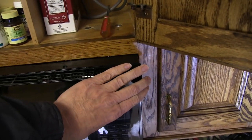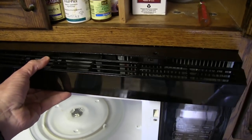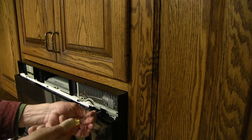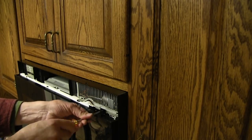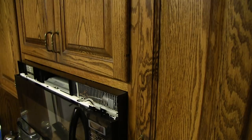If you own a freestanding microwave, you may have to remove all the sheet metal wrapped around the top and side before you can move on to the next step. The third step is to remove the top screw that holds the display panel in place and to pull up and pivot out that panel from the microwave to detach it from the unit.